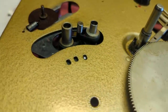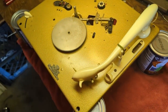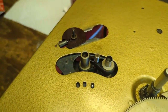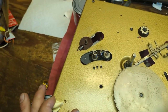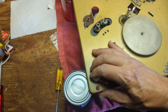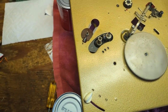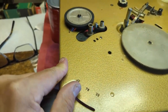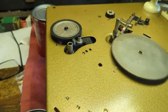I was patient, I ordered some belts. Thank you Gary at Voice of Music - he always does a good job. Look them up if you need record player parts, they have it. There we go - now it's operating both of those turrets. Now we should be able to change the speeds more easily. I need to install the friction wheel so it can engage with that. Let me put the friction wheel back on. Okay, so now this is working how I want it to work - there's 78, there's 45. I'm going to put the platter back on and see if that's going to work.